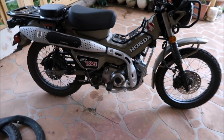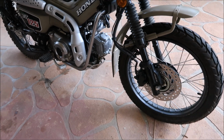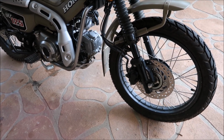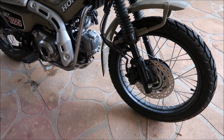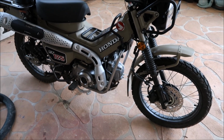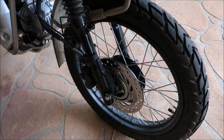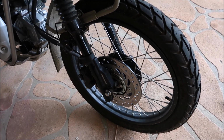So first up on this bike, you might recall that I did that slime test. Even though it recommended 8 ounces per tyre, I put in the 8 ounces and got the bike into a state of not really good balance when I was riding it, a fair bit of shake up front. So in the meantime, I pulled that wheel off, got the slime out of it. It didn't look too good after I'd done that, so I decided I'd put the original tyre back on the front. So that front tyre's on there, no slime in it.